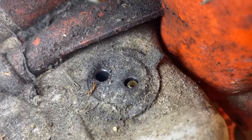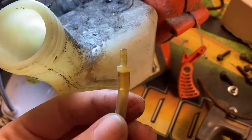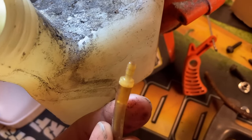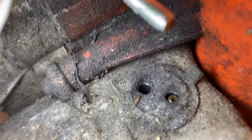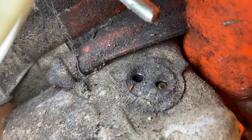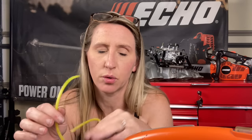Inside the grommet they use these little plastic connectors to put the fuel line together — the one I took out is right here, right at the grommet area. You do not need to use these to put it back in; the line will be tight enough when you put your brand new lines in. I got one stuck so I'm going to push it through into the tank and pull it out that way. If you buy the kit in the description box, the tank grommet already has the fuel lines mounted in it, so you just push the grommet into the tank and connect all your lines.